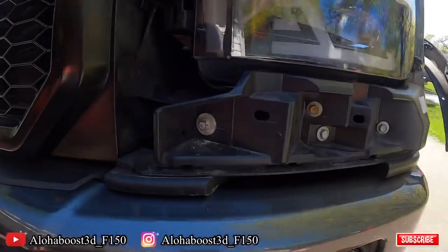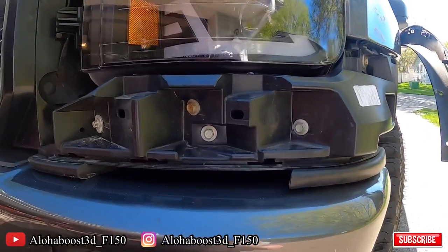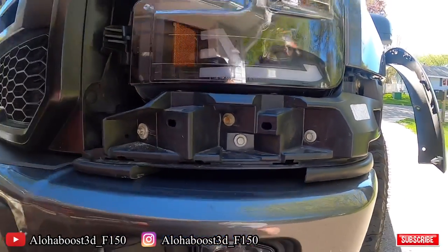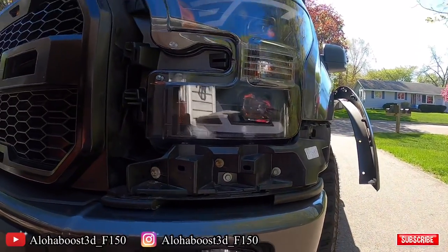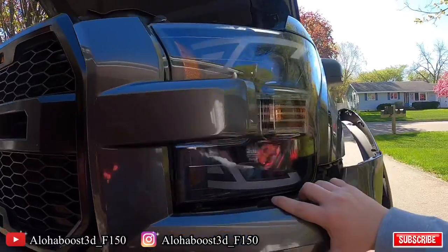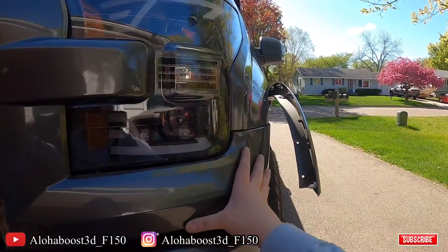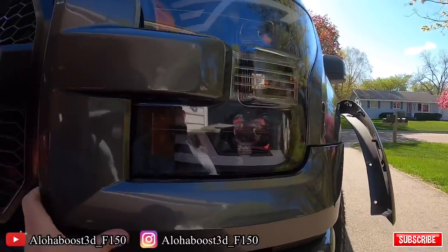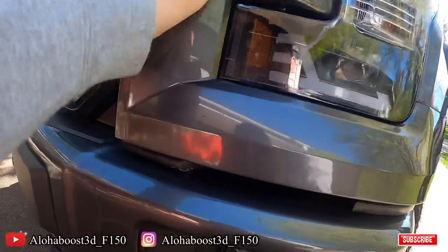Now that little trim piece, part of the headlight that attaches the headlight to pretty much the side fender, is in. We are going to be putting on the front housing headlight bezel. Slide this right in there. We have a whole bunch of clips. Doesn't take too much force to put this one back in. So just take your time. You don't want to force anything.